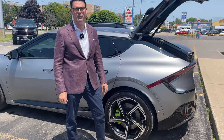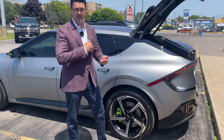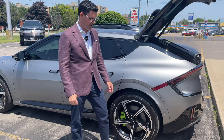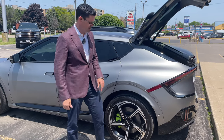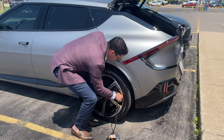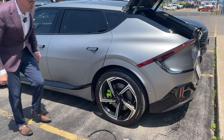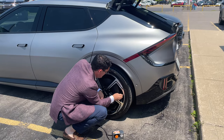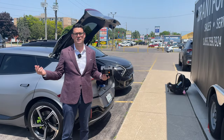Now what we want to do is take a little bit of a drive to let the sealant cover the tire, and then you're going to want to go to a dealership and get it checked. No more than 80 kilometers an hour and you really don't want to go more than 50 kilometers. I'm just going to disconnect this — I can hear my grandbaby crying — and check around. And that is how we do it.